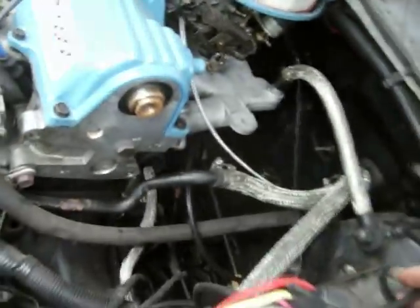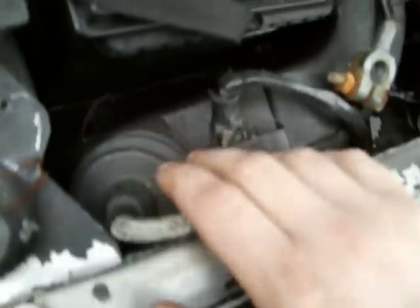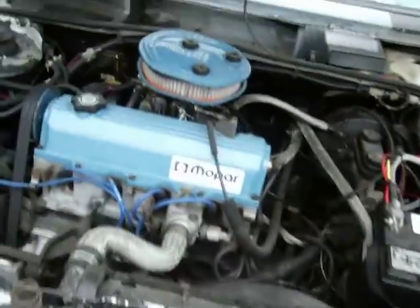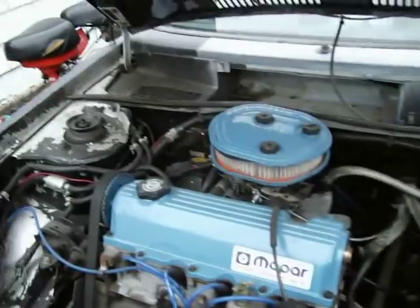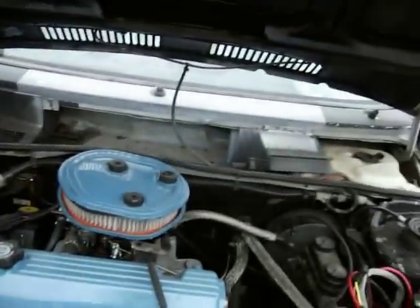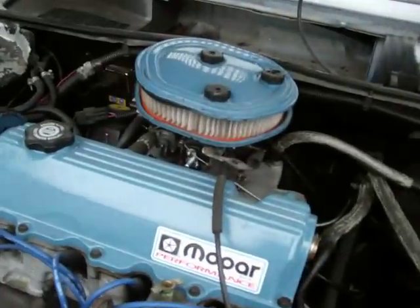The other main one is this one here. I don't remember if it goes here originally, but you just find a good vacuum source — I've got some steel braid on it — and it comes up to the computer, sending a vacuum source to the computer. Most carbureted engines in the older days didn't need something like this, but because this car is designed to monitor its own timing curve, that's the main thing. It also tries to adjust its air-fuel mixture through the carburetor, but that never really worked all that great — mainly it's the timing thing.